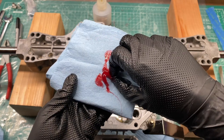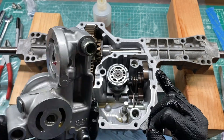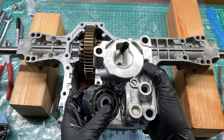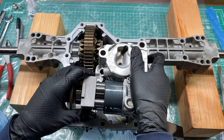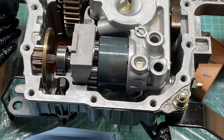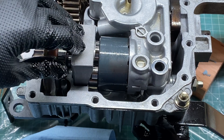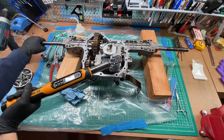My new pin arrived in the mail and I'm ready to assemble this for hopefully the final time. This time I'm going to be very careful not to push the bypass pin too far into the center case. Here's a pro tip from learning the hard way: before I crank down the center case, I'm going to actuate the bypass lever and verify that the little bypass pin functions properly by slightly separating the cylinder block and the center case. This little crack is what allows the oil to get diverted out of the pump and lose pressure so you can push your mower around without any resistance from the transmission.